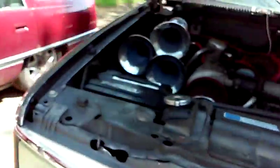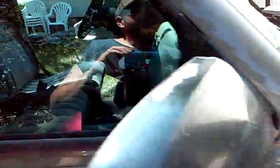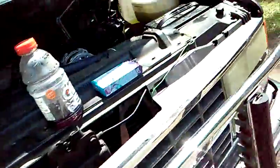I messed up my boost tube once, so I came over here to this grommet. If you look down there, there's a grommet — see the big red and black wire? It drops in right above your heater box. It comes in down through here. I ran the wires all the way through there. When you run your wires, run them all the way up into your dashboard.